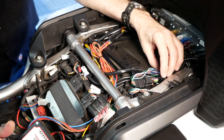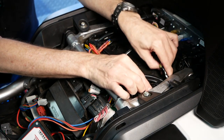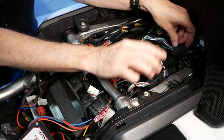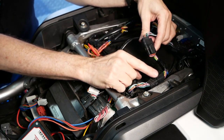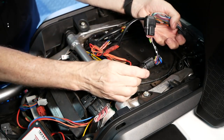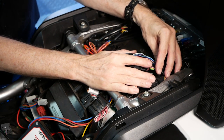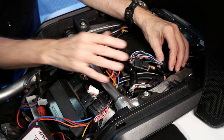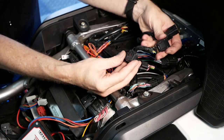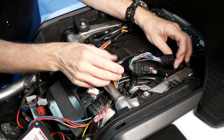Several different companies now have created these harnesses that fit in-line with the under-seat connectors on the Goldwing. I actually have two different ones installed: the ShowChrome harness and a harness for the Pathfinder LED. The problem is there's just not enough room for all these harness connectors under the seat of the 2018 Goldwing. I also have another one for my trailer that has to connect in-line for all my trailer wiring.